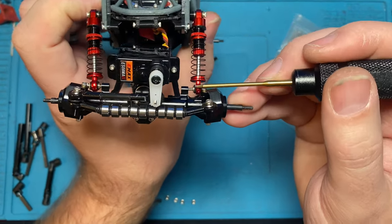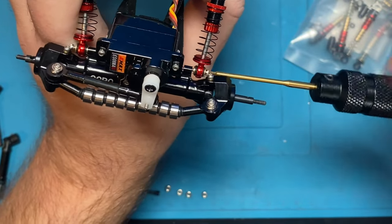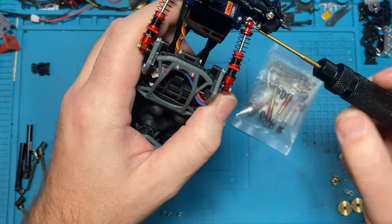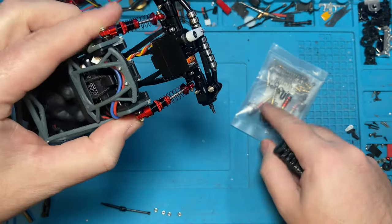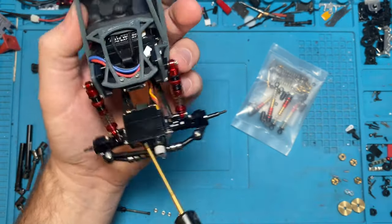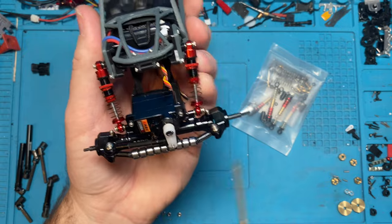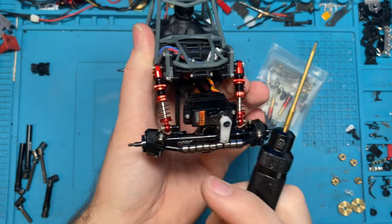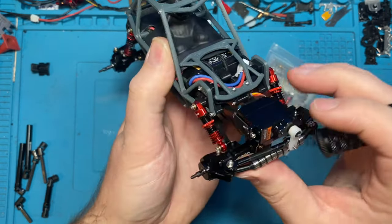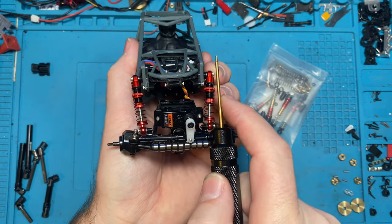And you can even see, look at our lower mounts. I mean, we're not even screwed all the way in. If we screw all the way in, let me show you what happens. Look at how angled these shocks get. And they definitely bind. I mean, they bind bad. So regardless of whether we use these 39 oil fills or these 43 double barrels, my guess is, in the picture they mount them up here, but we're going to have to put a small amount of spacer in here, make sure we're not hitting our knuckle, because this angle right here, the shocks are like this. I don't know if you can see it very well on camera, but they are pretty leaned outward towards the top, which is definitely not ideal. It's not the worst, but again, you want your shocks to be fairly vertical here, right?